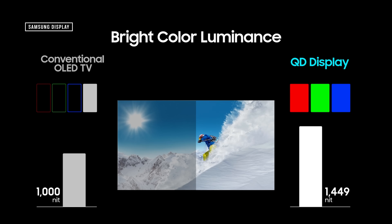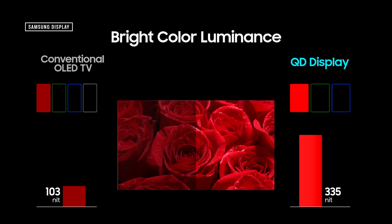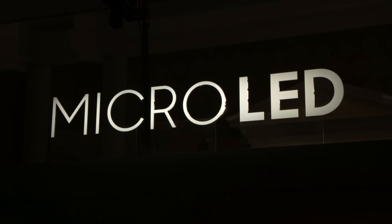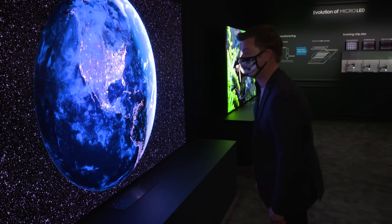The advantages are clear: higher overall brightness, higher color saturation and color brightness, more accurate colors, wider color gamut — we're talking somewhere close to 93% of rec. 2020 color space, which I don't think we've seen in a consumer display before — and all with even better black levels and shadow detail than before, plus sharper details thanks to superior contrast modulation. QD OLED is going to be insanely expensive for a few years, and it's not the ultimate perfect display technology. There's QDEL to consider — all-emissive quantum dots with no organic materials at all — and micro LEDs could prove to be a reasonable consumer TV tech someday. But for now, QD OLED is a great evolution of OLED technology, and from what I've seen so far, it's the most exciting thing to happen to TVs and gaming monitors in several years.